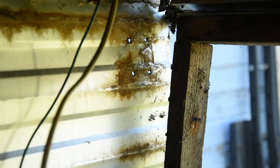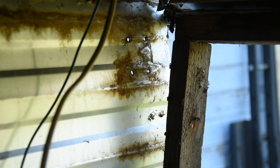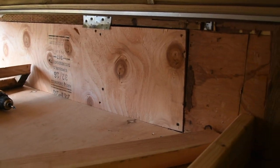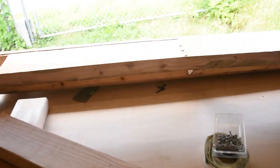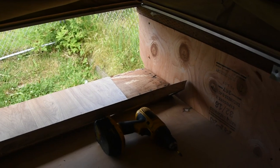I'm also going to add some more backing in for the latch to the roof — probably something a little more solid than what was there. I don't really know what I'm going to use yet, but it's going to start coming back together today. Right now I've got some half-inch plywood tied in over my internal framing on both sides, and it's freaking strong — I'm feeling pretty good about it. Up front, I'm getting ready to put this piece back in, which basically runs with the contour right there and forms the nose of the cabover portion. It's coming together, and I'm feeling pretty confident. I'm going to work on getting the front portion in and see how it goes. It would be really rad if I could start getting the metal siding back on tonight.